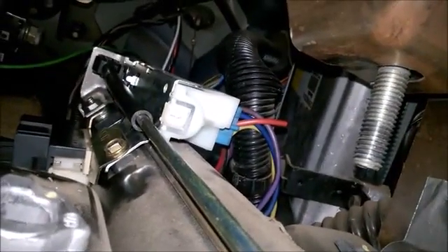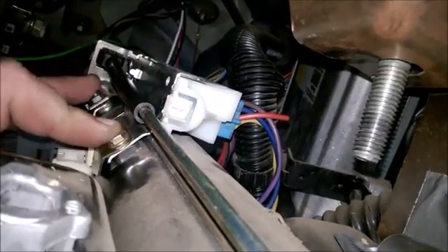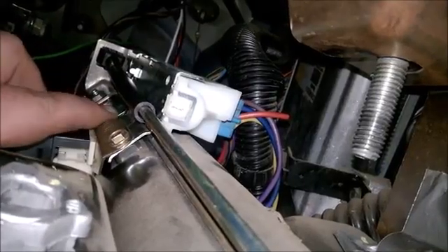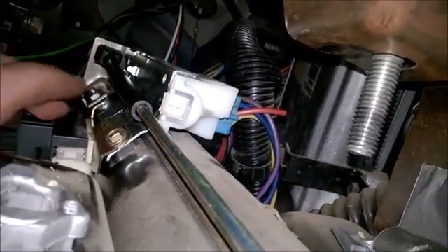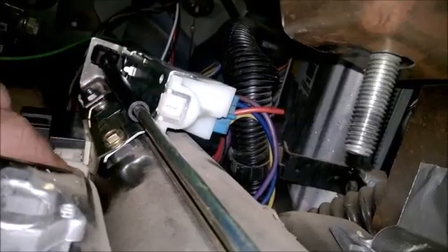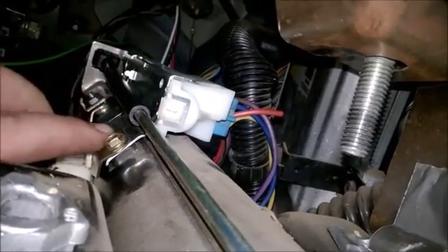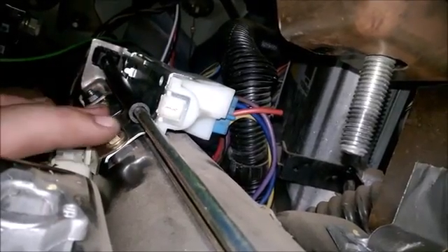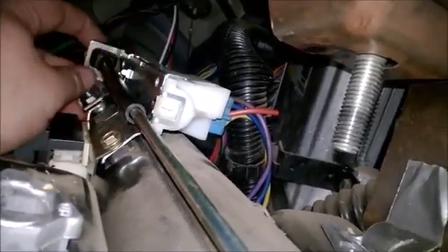I'm not going to take it out of park right now, but what I really wanted to show — sorry for the bad angle — is the setup to remove the ignition switch. You have to remove just two bolts, but it's kind of sandwiched funny. You actually have to install the back one first because it screws in but then has a stud on top of it. Then you take the box for the dimmer, which goes on second — it goes on top of the nut in the back but is flush in the front. These are 8mm bolts, and the front one is a 10mm.